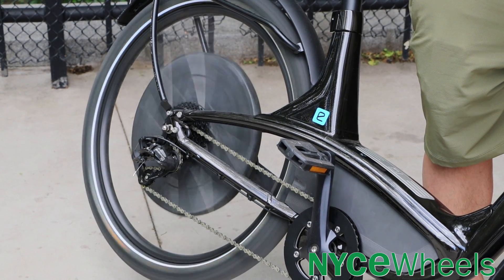Now because they operate with a series of magnets, when you reverse that current, it'll make the motor stop. Because a person riding an e-bike is not really enough weight or enough mass to use that stopping power to put battery back into the bike, you don't really get a whole lot of recharging, even if you do coast down a huge hill using regenerative braking or a regenerative mode.